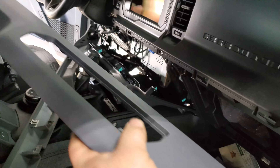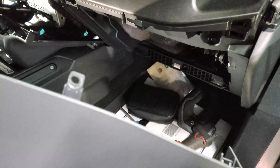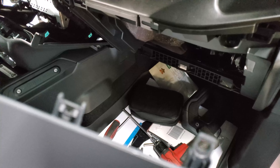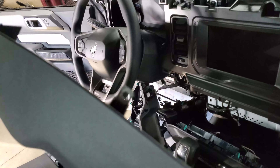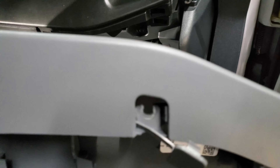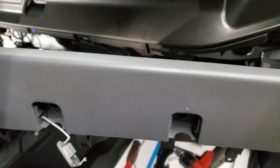So the next piece we're going to do is install the top dash trim. Just held on by a couple screws over the speaker cover, so you have to take the speaker covers out to get them. Other than that, they're just clips. So you have the screw here and one here, and then on the bottom side you have these three access pieces and those come out. So let's get that put on.